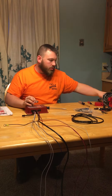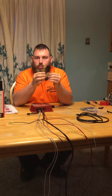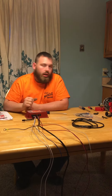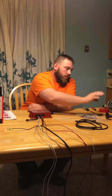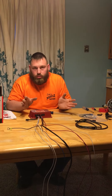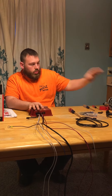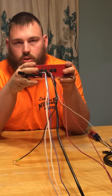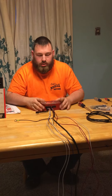With the stock distributor ignition control module, you're getting 12 to 14 volts to the coil — that's it. These are essentially junk for anything performance-based. After 3,000 to 4,000 RPMs they start to spit and sputter. For performance, you need something that amplifies your voltage. So instead of putting 12 to 14 volts to the coil, this box amplifies that to 535 volts to the coil — that makes for one hell of a nasty spark. If you're testing it, keep your fingers away from it. It will put you on your ass quickly.